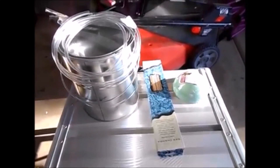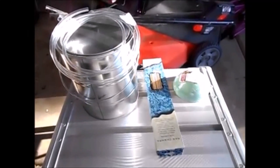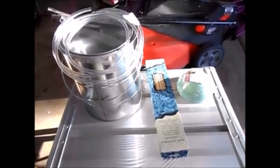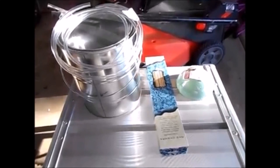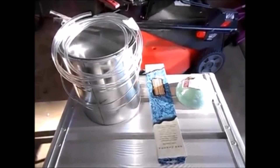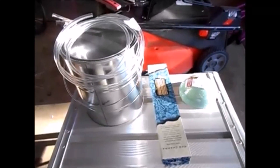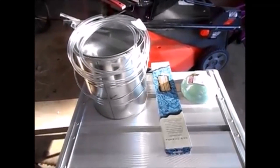Spoiler hint: if you see this part of the video you'll know that this works. I need to track down a vacuum leak on my '89 Cherokee. If you watched my previous video, it's pretty bad. I tried using carb cleaner to find it and I have not been able to — the idle is kind of all over the place because of the vacuum leak, so I haven't been able to tell if where I spray has any effect. I'm going to try to smoke it.